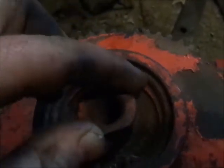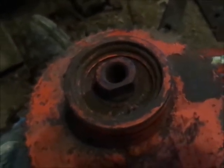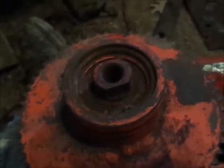But here is the good used starter clutch I have. It's orange. You can see somebody brazed this pin in here, which doesn't really bother me, but that's the reason why I never sold it to anybody. I kept it, but as you can see it freewheels, and it catches. Freewheels, catches, and it does it very nicely, so I'm going to assume this clutch is in fairly decent condition.